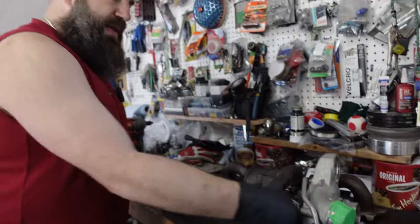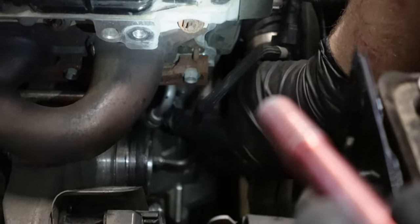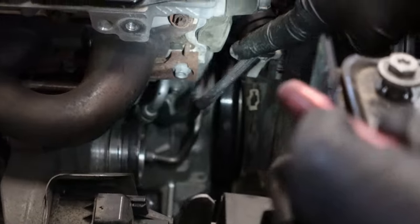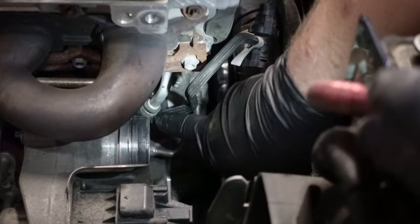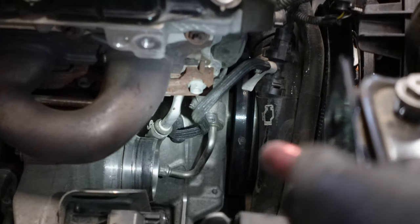We're gonna look for those, remove it, and see how long it takes to pull the turbo. Here's the one right here. That looks like it's gonna be either the coolant feed or the coolant drain. So we're gonna reach in there, but this hose here is a vacuum hose that is easily broken. So we need to be extremely careful not to catch it, because just inside here, it always ends up breaking off, and the last thing I need to do is break that.